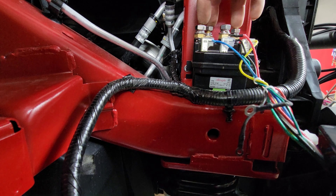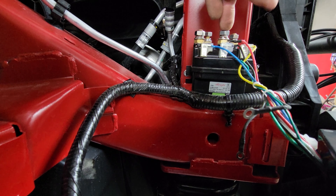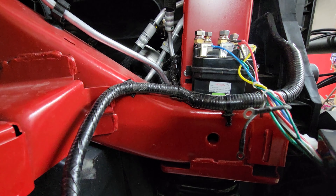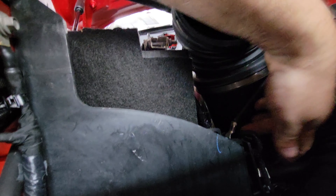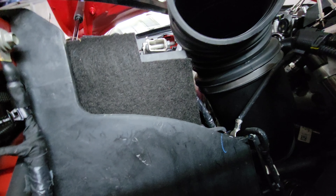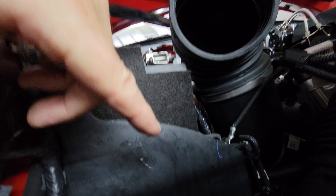Then I can run my cables in and around and bring them in to each side, running the three leads — F1, F2, and armature — going to my winch, as well as run my battery cable right up to my battery. The other thing I found on this truck is right here — this is actually part of the ground system, and we're going to tie into it. I've got to do a little bit of research because I believe these newer trucks have a breakout where this is only rated to about 200 amps.